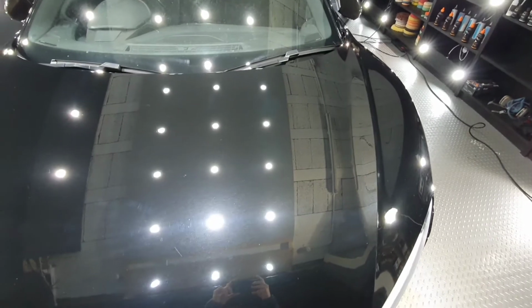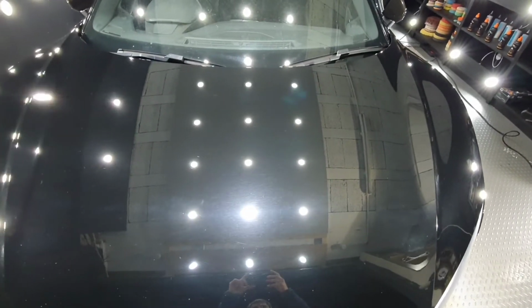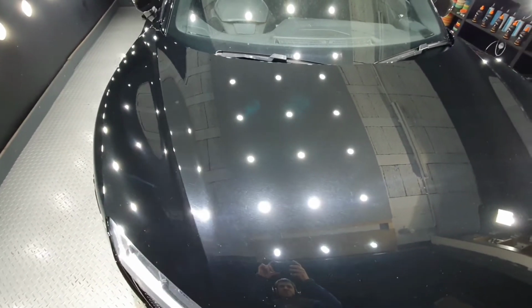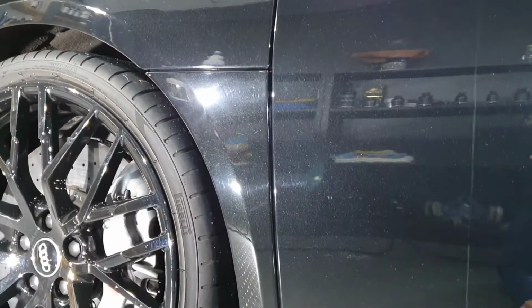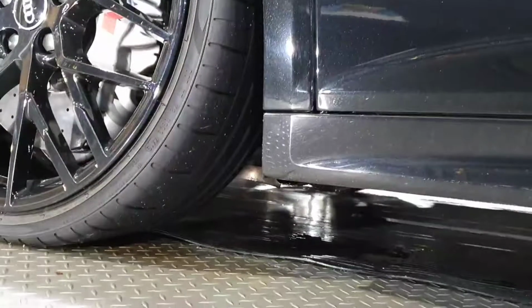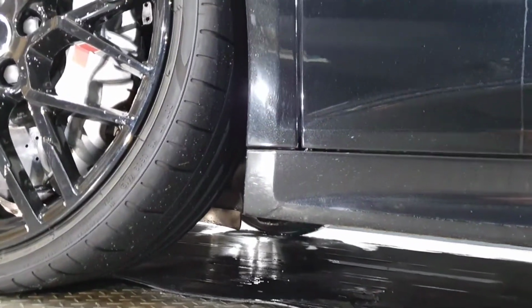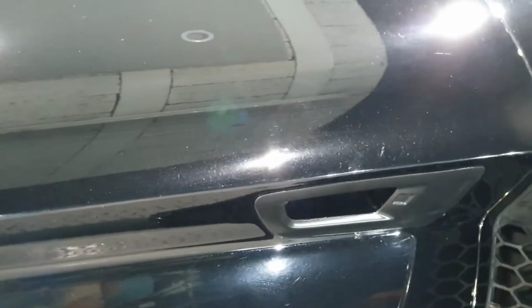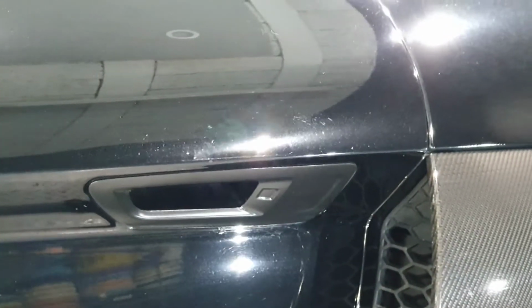What you see here is damage caused from general wash maintenance and probably from the pre-sale preparation. Over time the vehicle has accumulated surface damage ranging from basic marring to swirls and scratches. This is due to mechanical abrasion during what was probably a poor wash routine and very possibly from cheap wash media also. You'll often see heavier damage around areas like handles and gloss blacks and other places where the vehicle is touched more when doing things like opening and closing doors.